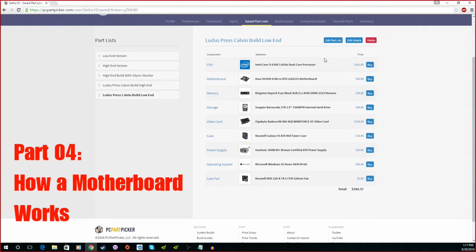On PC, Batman Arkham Knight had issues where the game would stutter constantly as it tried to load in new areas of the open world. Whereas on consoles, that was not an issue at all, and people couldn't understand why PCs, regardless of how powerful they were, were having issues with this. The reason is that every PC still uses that discrete motherboard, and so there was that fraction of a millisecond where the data had to go from the memory to the CPU, and from the CPU to the GPU, and then back to the memory. And that whole process, even though it only takes a fraction of a second, there were enough big objects there that it was not doing it quickly enough.